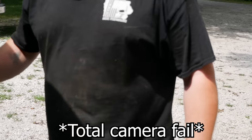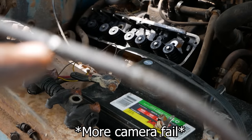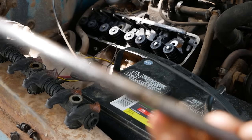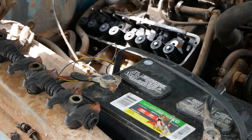This jet, by the way. So the question is, why is this bent? I'm seeing two marks right here that look pretty fresh, and a couple more scrapes that look pretty fresh. So I think this might have just happened. That might be because we have a stuck valve. We'll go find ourselves a soft hammer and see what we can find out.